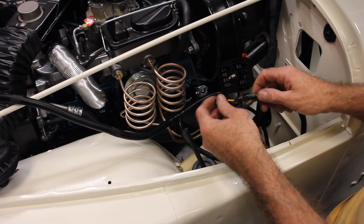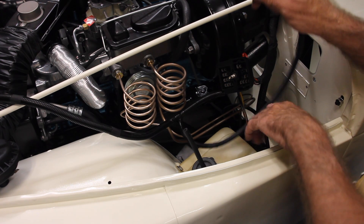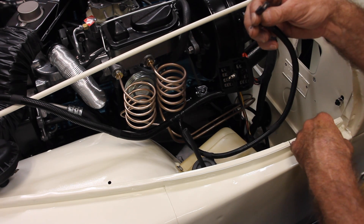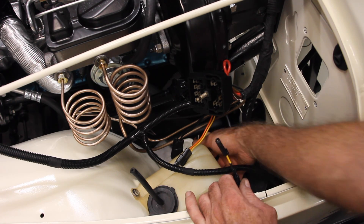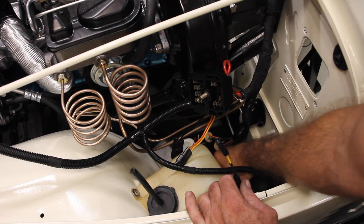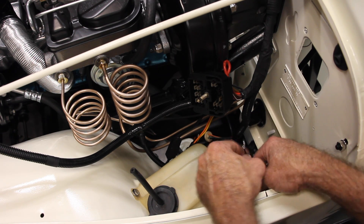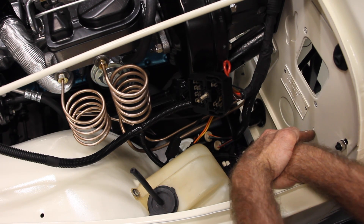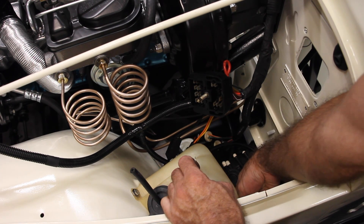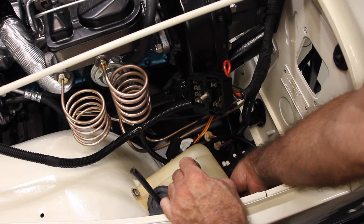Next is a yellow wire that connects directly to the wiper motor right underneath your washer tank — it just slides in and connects on nice and easy. The wiper motor is right underneath the tank. It's a flat-prong connector. There's also a ground line that comes from the wiper motor — I'm going to ground that right here on the firewall. The connector is right underneath the driver's side of the fender; you just have to kind of feel your way in there.